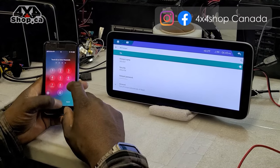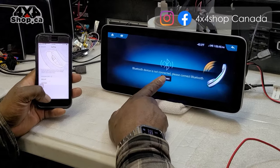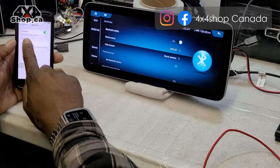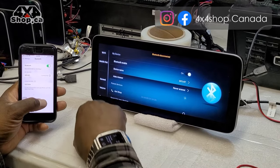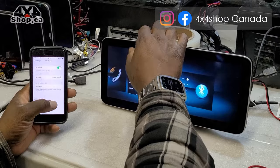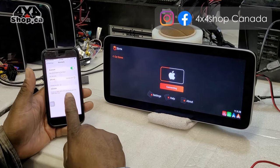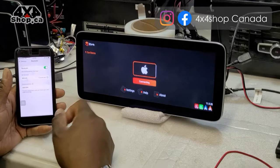You may notice in your Bluetooth menu that the Bluetooth device has disappeared — that is a normal function of Apple CarPlay, because it uses Bluetooth as a gateway to access the access point for the system. To set up: go into Bluetooth and search for Bluetooth devices. This one is automatically generating the password, so just click OK and allow your contacts. Then go home and go to Z-Link, or Z-Link may be in your app section. Wait for it to initialize, and the prompt will come on your phone asking if you want to use CarPlay. If this prompt is not selected, CarPlay will never come on the Android system.